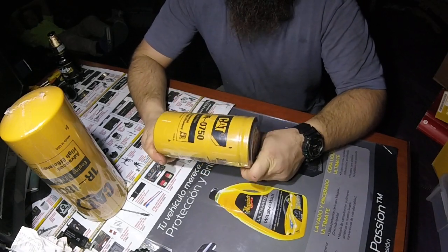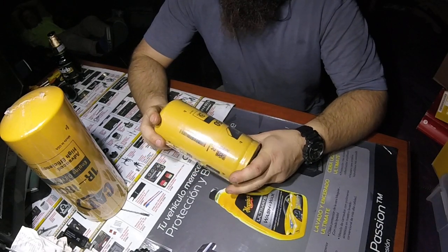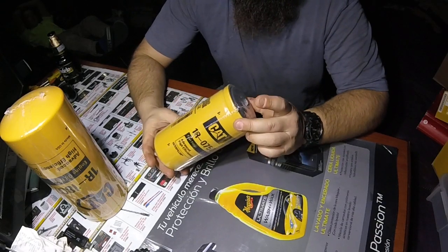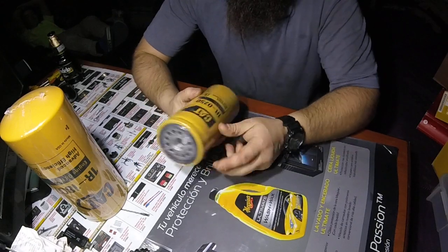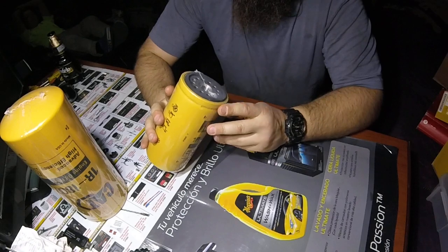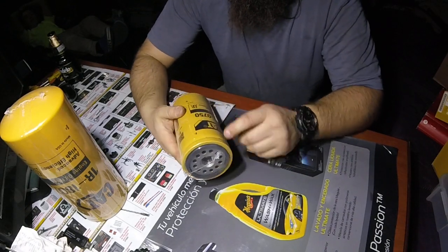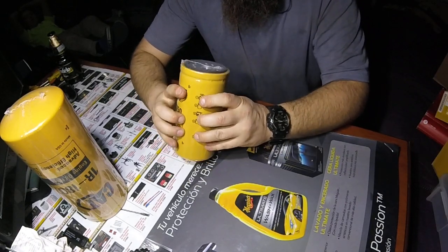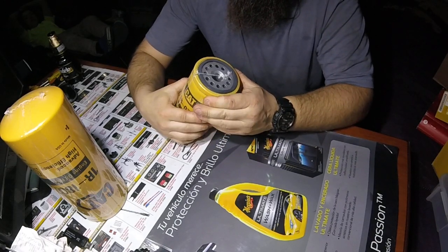That's why a lot of guys with other diesel engines like Duramaxes, Cummins, Powerstrokes, end up doing filter housings that take Cat filters. When it says advanced high efficiency, they're not playing around. 2 micron is a really fine rating for a spin-on filter, and it also has a very, very rigid canister, and a nice cast aluminum